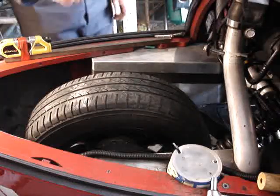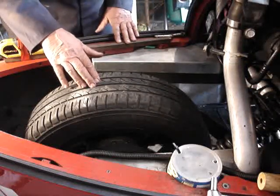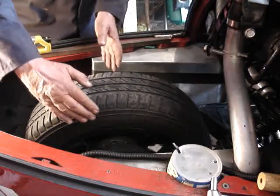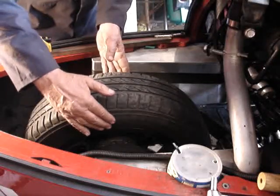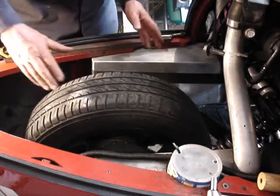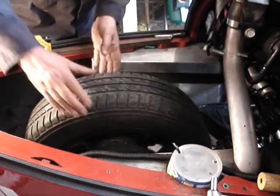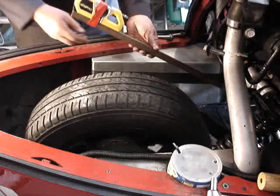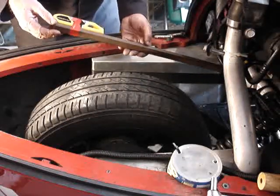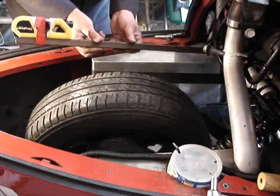With the rear wheel in position, we now need to line it up with the center line of the vehicle. The first thing we do is measure the width of the tire. I'm working off the tire because it's rather more difficult to work off the rims, and the tire is what's actually on the road. The width of this tire is 180 millimeters. I'm using a cheap and simple laser level, which I've crudely attached to a piece of steel box section which is nice and straight.